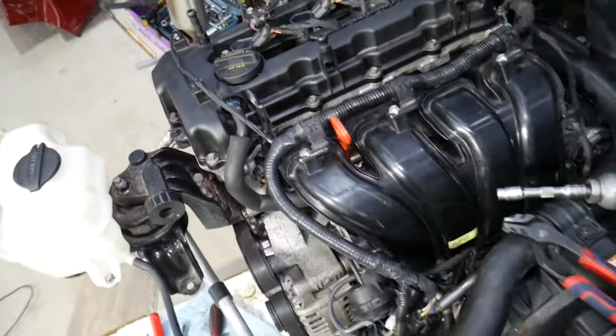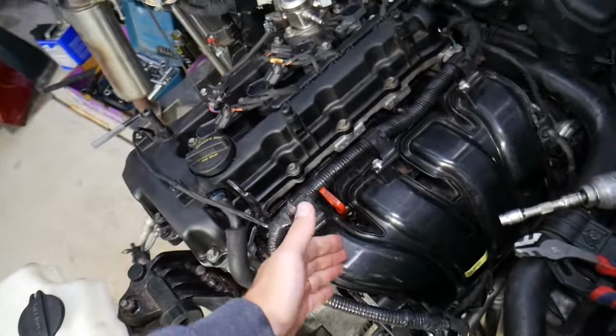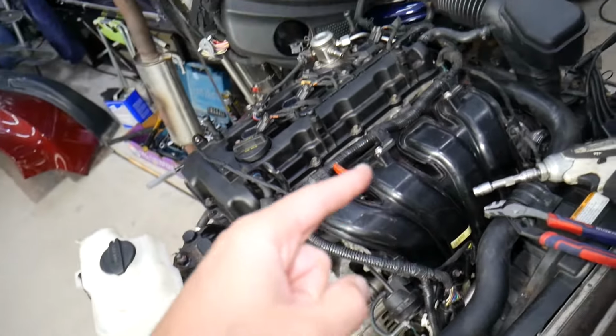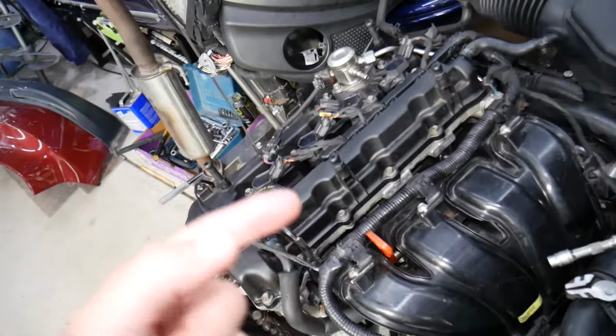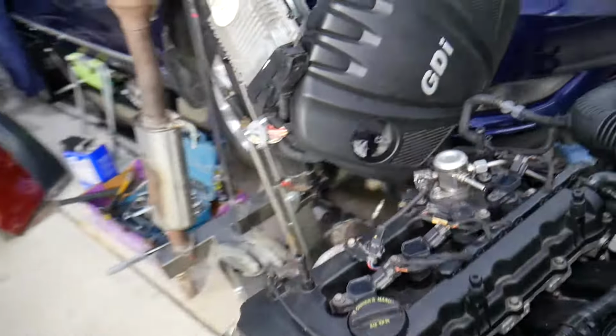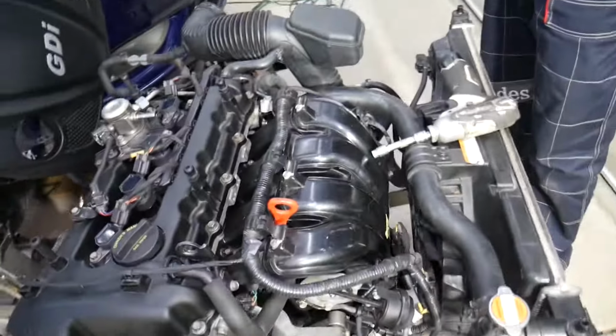Now, next, you need to disconnect the car battery. Why? Because when you're removing the intake manifold, underneath you have the alternator and the engine starter. If you touch a positive battery wire that goes to the alternator or starter with a tool, you can cause damage to the electrical system and engine computer modules, and that can be, guys, super expensive to fix.